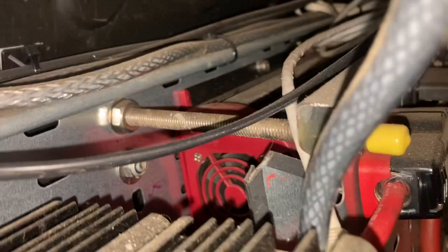The height of summer it can get very warm inside vans, so you may come a cropper there. One thing to consider is mounting on cable tray — I've used cable tray here because it's not only practical but it dissipates heat. Regardless of whether you use the Stirling or the Victron, they both have heat sinks, so mounting onto a metallic cable tray surface rather than onto wood is well worth doing. Cable tray is great because it's got holes in it for airflow and heat dissipation.